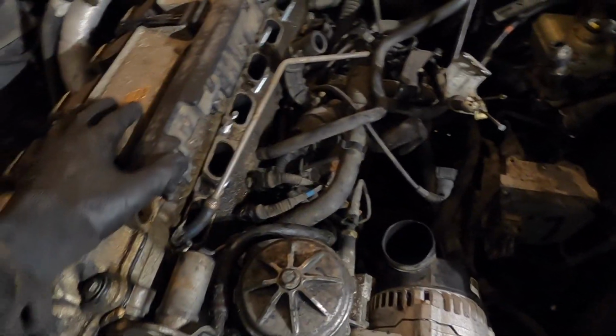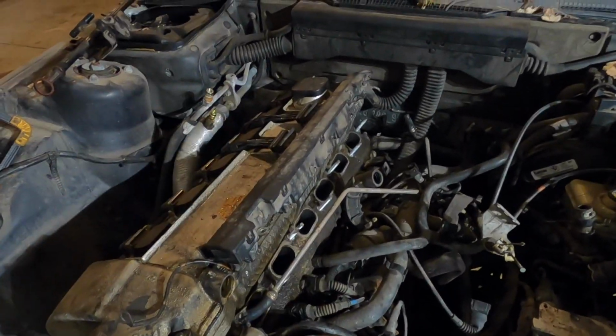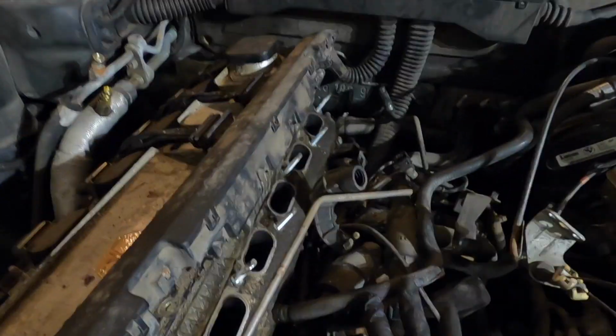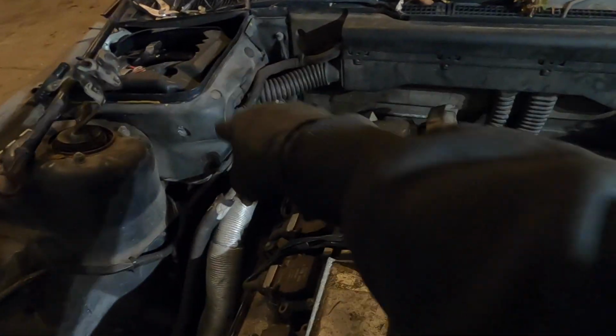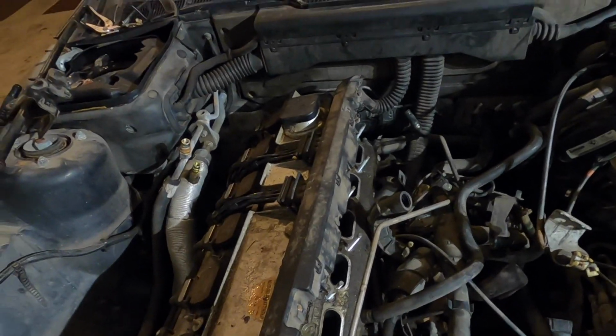So now what I'm gonna do is pull off the coolant hoses. You don't need these. Most of the times I pull the harness off the motor when I pull these because I sell everything separate. But like I said, I think I'm selling this whole motor together. So I think I'm gonna leave the harness all attached to the motor. And then when I pull it, you just gotta undo it from the firewall, pull it out of there, and then it wraps around into this, pull those, and then the harness will come with it. So I'm gonna leave that for now.